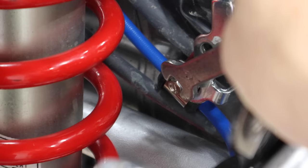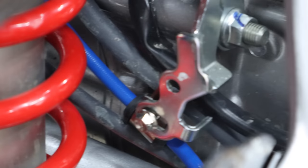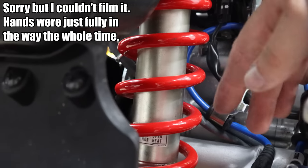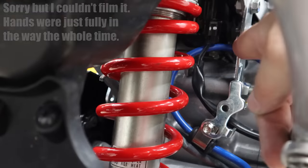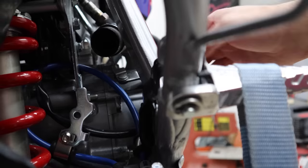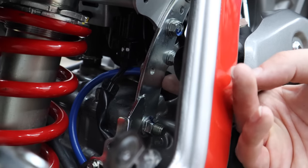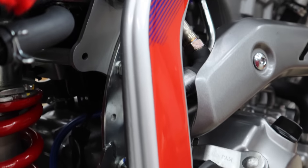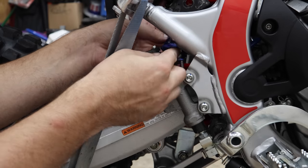You can see where we've added our first P-clip to hold the line — that should give us enough bend there. I went back and forth a bit with the routing. Ultimately, what I've ended up with is it comes up through this P-clip, does a loop, travels around this bracket, and comes down through another P-clip mounted right there. Still a pretty good distance between the exhaust. Also worth noting, it's not actually touching that bracket — I wouldn't want it just resting against that, as that would cause it to chafe over time. It's making a big loop, but this gives us what we need.